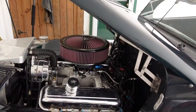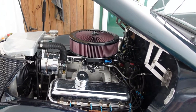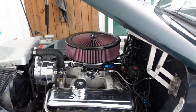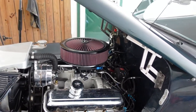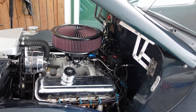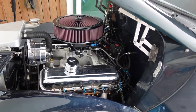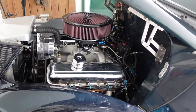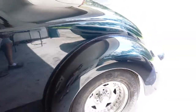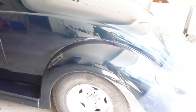Got a little bit of idle hanging going on — just a touch. I've got it set for 700, now 650, but when I come back from a drive it'll be idling at like 900. Shut it off, turn it back on and it works again — not quite sure what's going on there. The IAC seems to be hanging; it's at 20% so not a biggie. I'll keep tweaking at it, I think there are a few settings I can play with. No big deal, she's running good. Got some dirt on it because it's so crappy and muddy, fuel gauge is working, looks good.